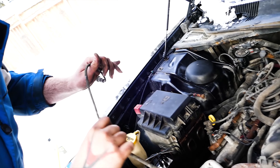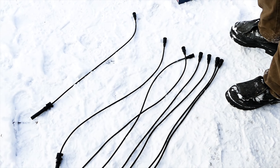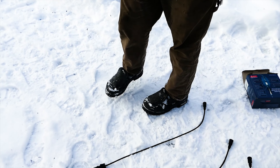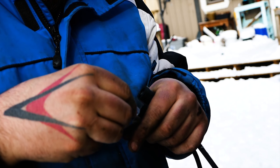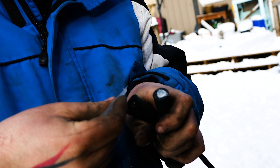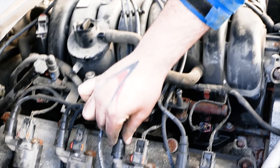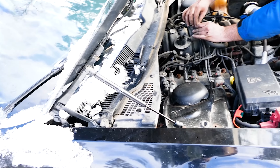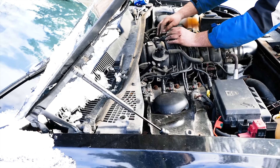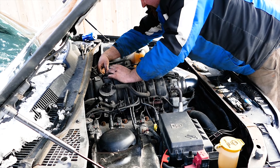Since we have the first one off, let's lay all the new spark plug wires on the floor flat so we can see how long each new wire is. The spark plug wires vary in length, so take the old spark plug wire and find the new spark plug wire that matches its length. Once we have the new spark plug wire with its matching length, let's throw some dielectric grease at each end of the spark plug wire. Next, let's connect the spark plug wire that has the short connector to the ignition coil. You should hear and feel a distinct click when you make the connection. With the short end of the new spark plug wire connected to the ignition coil, snake the new spark plug wire in the same position in which you removed it. When you encounter a retaining clip set, simply place it in its seat.